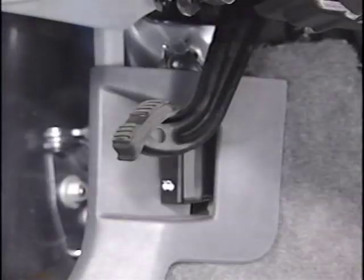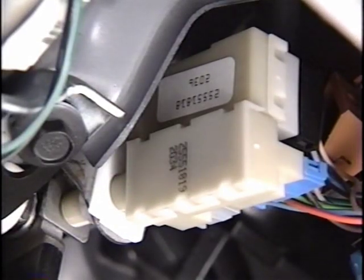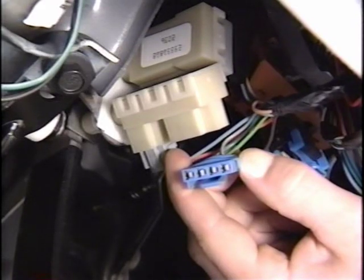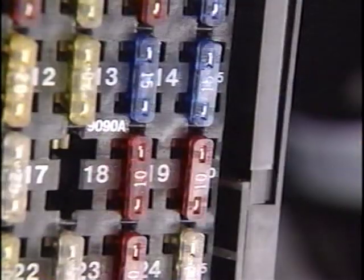Checking the interior first, test the park brake and brake warning indicator to ensure that the system functions properly. If the indicator doesn't light when the pedal is depressed, check the park brake switch connector — the connector may be loose or the wire may have backed out. If the brake indicator doesn't illuminate, perform park brake switch test W in the ESM. Check the cruise shift interlock brake switch and the TCC anti-lock brake switch for loose connectors or wiring. Check the terminals to see if any have backed out or are corroded; repair or replace any damaged terminals. Switch the ignition to run and check fuses number 6, 13, and 19. If a fuse doesn't read properly, remove it for a closer look. If it is actually blown, this is a sure indication that a wiring problem exists in the circuit it protects. That completes the interior inspection.